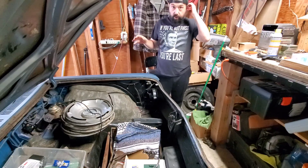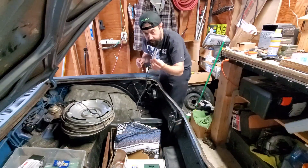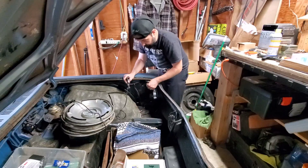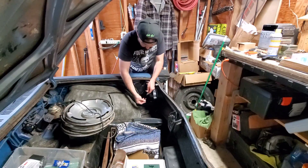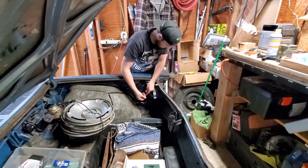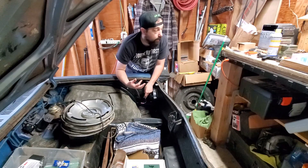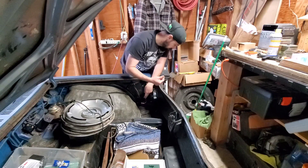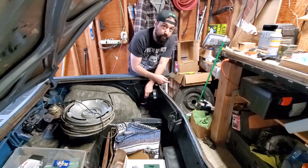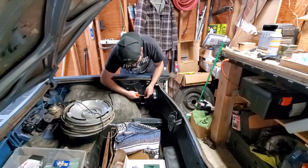I don't have a wiring diagram, and the way I know this is going to work is I know that one of these two has power based on my test light, which I have hooked up over here. So that one has power and that doesn't — that means this is for the blinker wire and this is for the parking light or running light, so I'll just plug it in here. The way the bulbs work is there's a bright one and a not so bright one, and one puts out more light than the other. I just know that this is the parking light — it's not very bright. Sometimes you'll see cars driving down the road with one bright tail light and one not so bright tail light and they'll have problems.